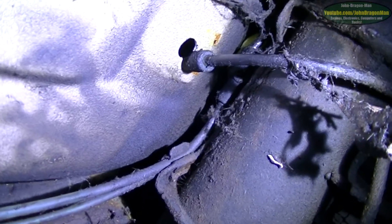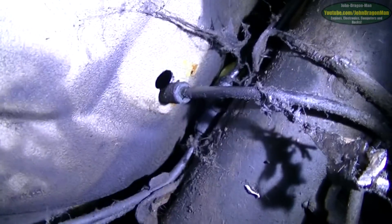It was a tee piece at some point in time. It is a return — there's a clear pilot block with LHM in it. All of these returns are going to get replaced — replaced with nylon. These might not be replaced as they're already clear nylon pipes, but anything rubber we're going to get rid of. Like this pipe here — it's going to be changed out. It looks like a breather of some description going into the rear beam.